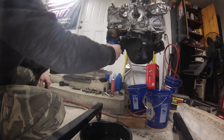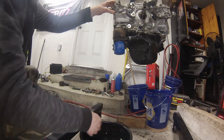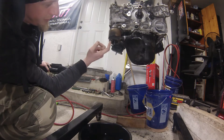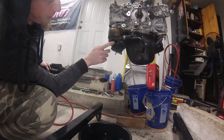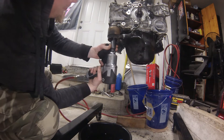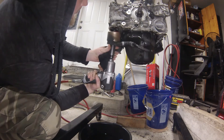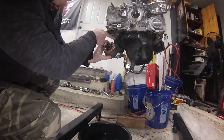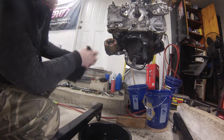Now go ahead and get the oil filter and the oil cooler off. Definitely have a drain pan because there's definitely more oil in it. This threaded center section has a 24mm nut on the top — that's basically where the oil filter is threading onto. If we thread this off, it will just act like another oil filter and come right off. Then there's just one last hose for the water in the back here, and I'll also have to probably take this fitting out that the hose connects to, to thread into the new block.